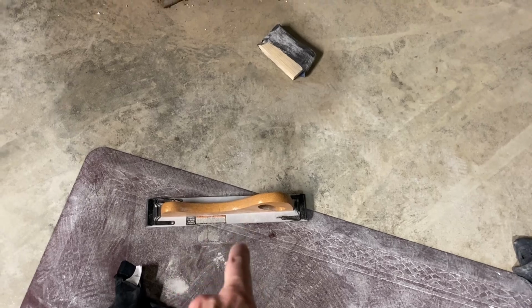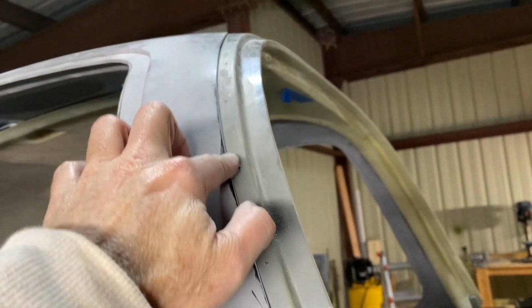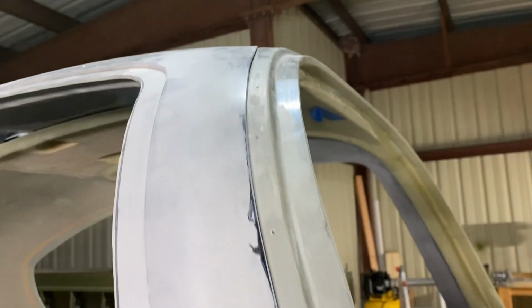Now, what I have done is I'm still using the 12-inch sander. I use that for really moving some coarse stuff. Like for instance here, I can see that it's not close, so I can use that to sand it down. And then I have a wooden block over here that I use to put in the bevel, and also on these curved surfaces here, just to kind of cut that in. And you can see up here, see how the gap is coming in on the 45, right up here. So it's getting there.